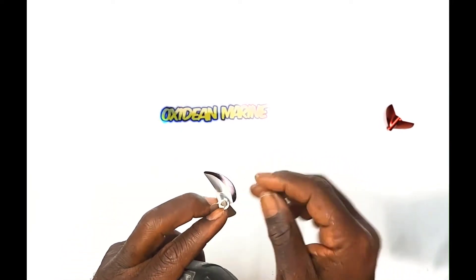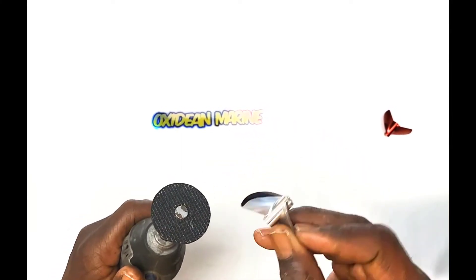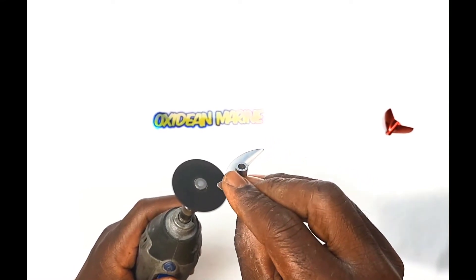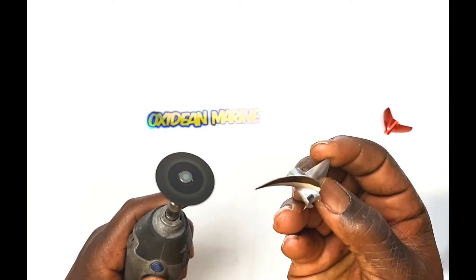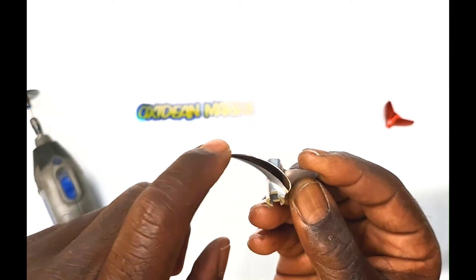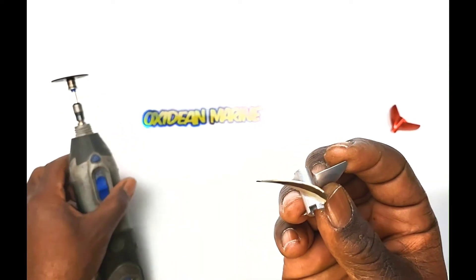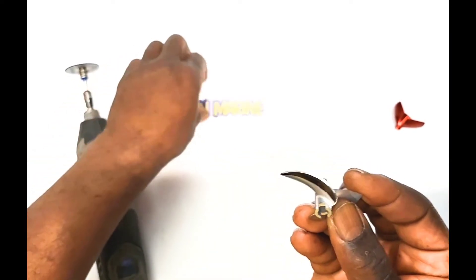What you can do is color it with a Sharpie — make sure you cover the whole trailing edge and that it's coated well. When you glance it, I'll show you guys my first pass here. Now you can see the edge — you can see where I barely glanced it and sharpened it. This one could use another pass. Now I held it at a slightly shallower angle, and what I've got here is razor sharp — sharp enough to cut this sticker.